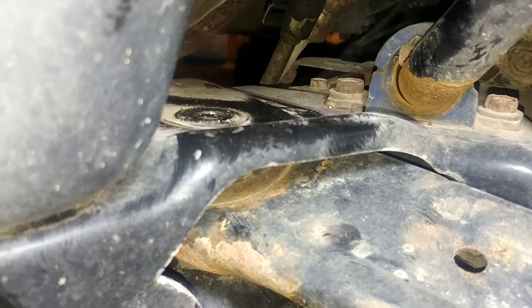And then you're gonna take off right here the ball joint, and then you get out the whole control arm. I already took my bolt from that bushing right there, the one from right here. We can hold the ball joint and you can see the one right there.